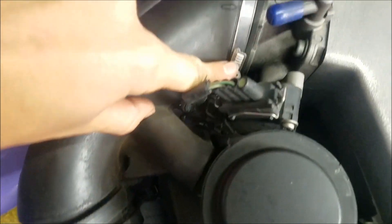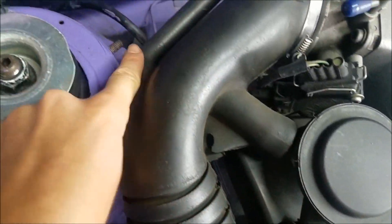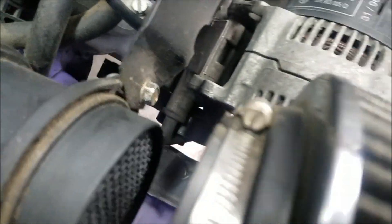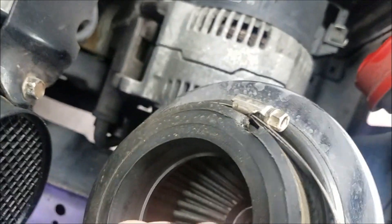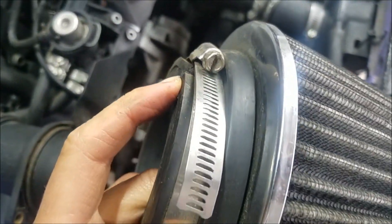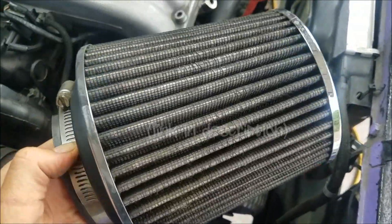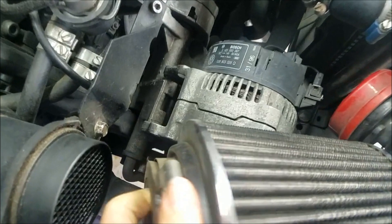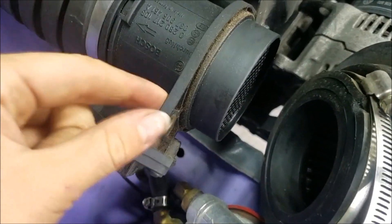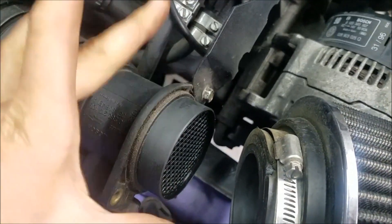Then I'm going to remove this hose clamp right here and this will pull off as well. I also remove the air filter so I can get to that bolt and nut. In order to clear that — since I've had someone ask me this — I cut a little hole in the rubber boot of this air filter. This is a Spectra, just like a $20 or $30 air filter you can get at NAPA, AutoZone, or whatever, and now I can access this bolt. The mass airflow sensor naturally has these two holes in it — I just used what was already there and clocked it accordingly.